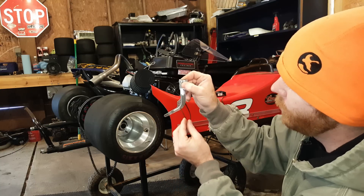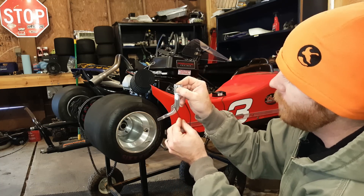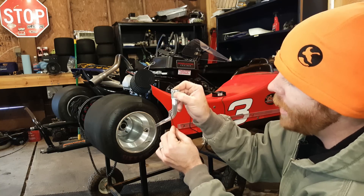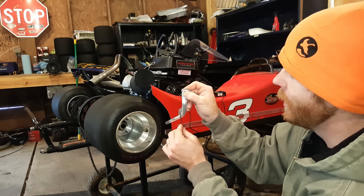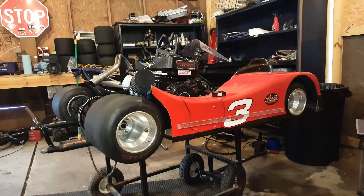You want to move that gold spring to the middle position — that's going to get you close. You can experiment and move it back or try different locations, but I use that middle hole and that gets me close, as you're going to see in the video. One other thing I did not mention in the last video is the throttle stop screw.